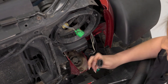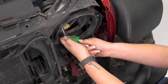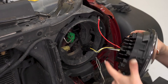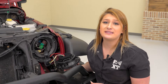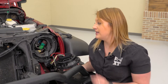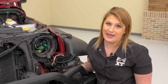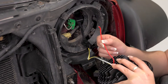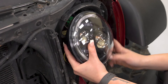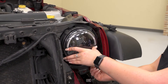You can rest your headlight on your bumper — just be careful, don't scratch the lens. Go ahead and plug in your connector. Once it's in, you should hear it clip, and you can tuck your wiring in the back here. You're gonna have enough space to fit it in. These headlights will only be compatible with JKs that have stock halogen headlights. If you have the LED package from the factory, this grille surround will not be able to accept an LED light like this — you will have to get an adapter for that. While you're putting the wiring through the grille, if you are running this to the parking lights, tuck this in between here so you can access it on your turn signal wiring harness, and make sure your halo wire is on tap.